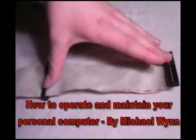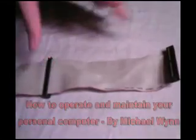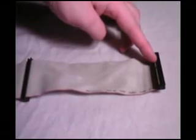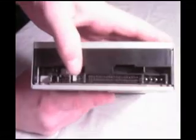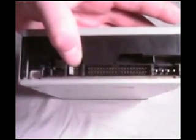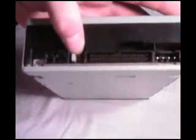On an IDE cable, you'll typically find three plugs. Two are closer together, while one is a bit isolated. This isolated plug is the one that connects to the motherboard. The plug in the middle is the slave, while the remaining plug is the master. So, if your new DVD burner is connected to the middle IDE plug, make sure the jumper in the back of the device is on the two slave pins. Both IDE and SATA plugs have notches, ensuring they cannot be hooked up incorrectly.